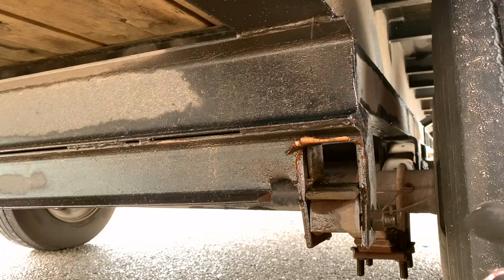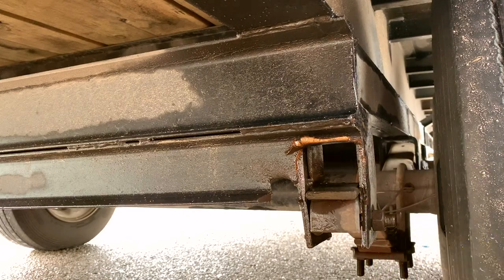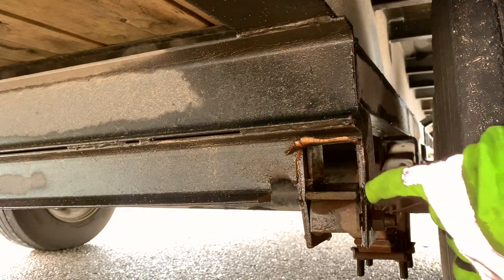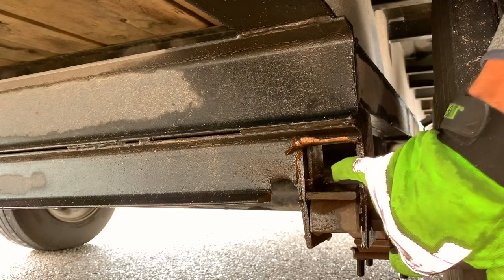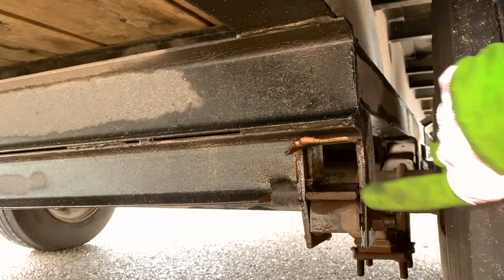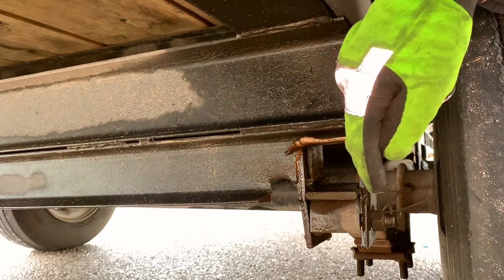Now the leaf spring is no longer right up against the C-channel. Our goal is to put some steel in there, but as you can see here's the other piece right there. All of the weight is riding on those little welds and that's it - this is the single point of failure on these trailers. I don't like that. It's not that hard to put something right above that, so I think I'm going to fold this back down and then put a steel on top.